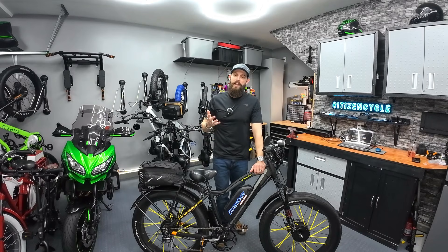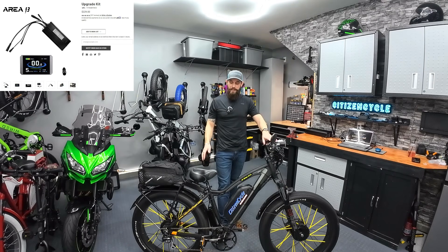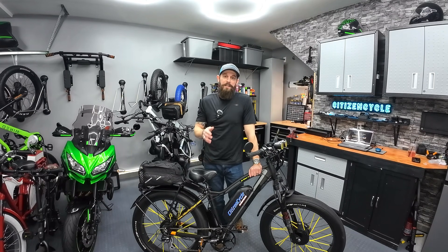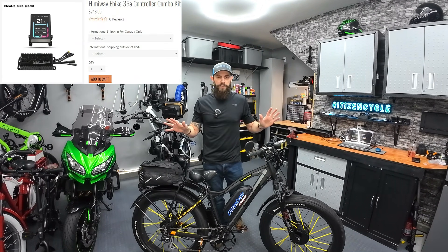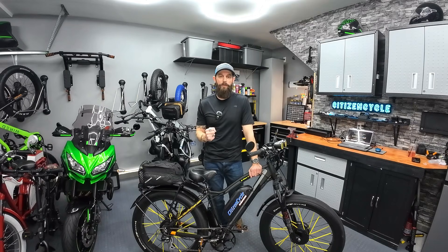The easiest way to get more power is with a bigger controller — higher amps on the controller. I found Area 13 E-Bikes made a Rad Power upgrade kit. They give you a 35-amp controller and a new display screen. It's plug and play — you just plug it into your Rad Power bike and boom, you've got tons more power. It was like $220 for that kit, and man, was it worth it. There's also one out there for Himiway bikes at electrobikeworld.com. If you luck out and have a Rad or a Himiway, you can buy an aftermarket controller upgrade kit and get more power very cheaply — it's a great bang for your buck.